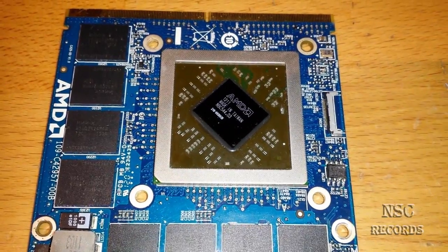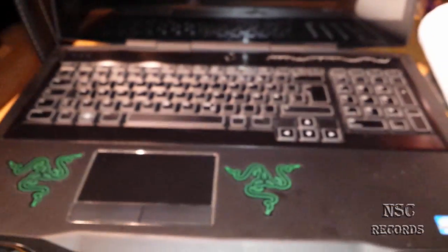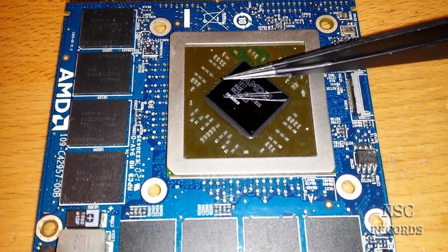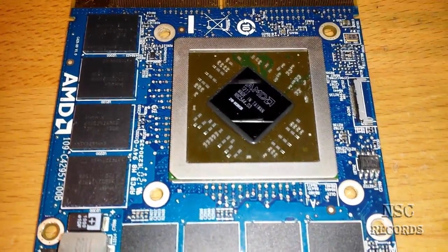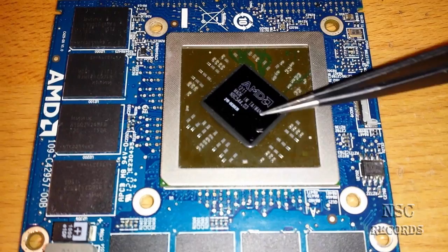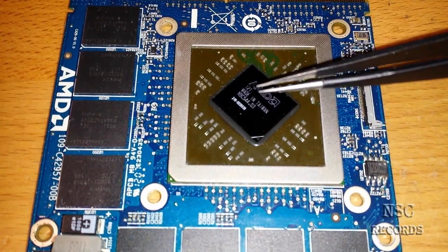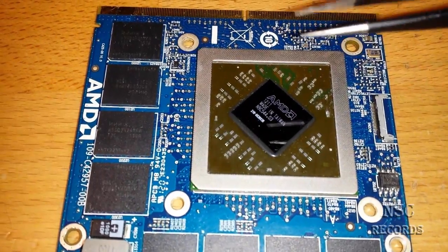So you got here, like you can see, the chip itself. This is the die. This part here needs to always be very well cooled, otherwise it will overheat over time. On these special GPUs for powerful notebooks, the cooler sometimes doesn't sit perfectly over there. Sometimes you just have half of the die with great pressure, and the other half will run a bit hotter. This will bring you, over time, a lot of problems. It begins with some texture errors and pixel errors, and this can go till it will completely overheat.